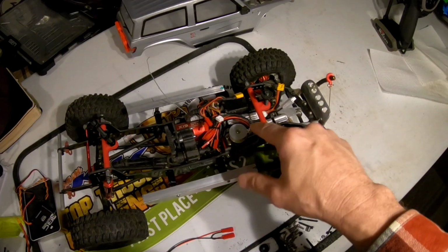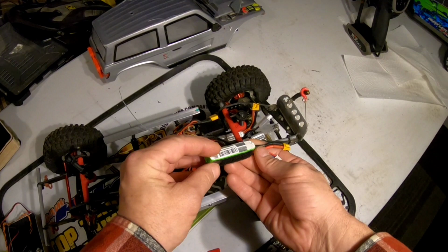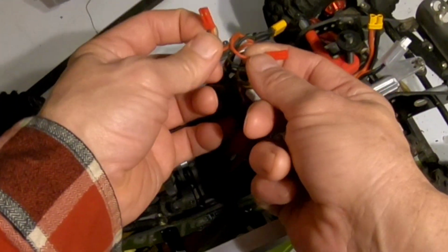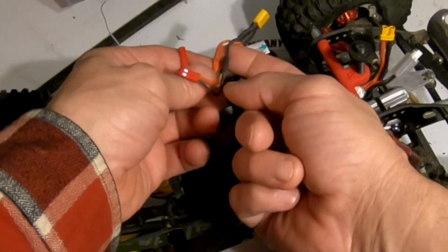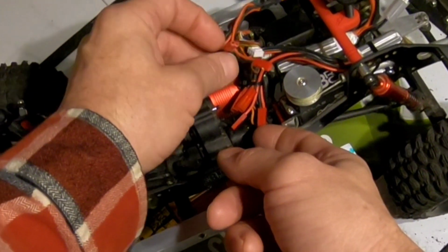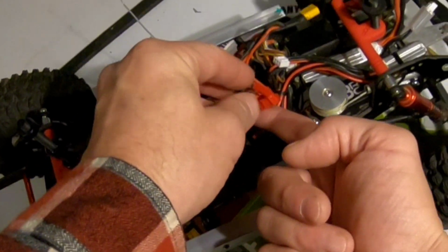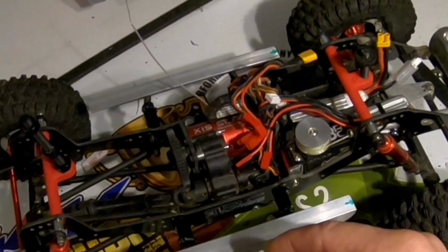I'm going to run a smaller battery. The battery I have right down here is a 2S, and this weighs only about 1 ounce, and it's a 450 mAh also. So what I normally like to do is I'll take a double male JST connector and I'll solder it in to the ESC battery wire, just like that. That's where I soldered it in. So I'll permanently have these two females are my winch and servo. And I'll just permanently connect that. So it's always there. I don't have to unplug it. So I'm unplugging and plugging back in as the battery itself.